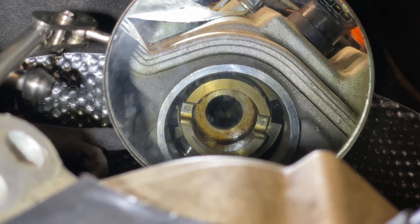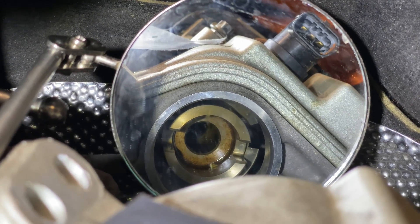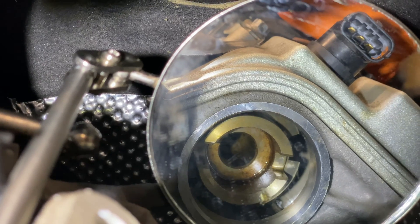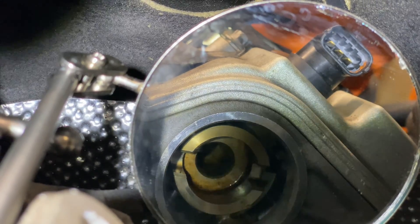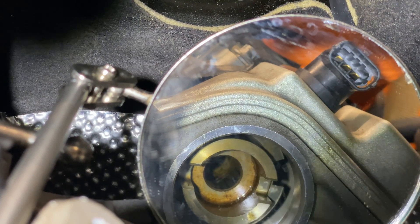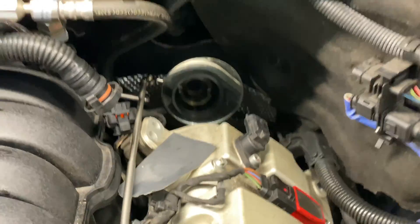We got that out — that is how it should look before you install the new plastic piece. You need to make sure you can see that tan color inside the hole before you put the new plastic plunger in. See how there's no more black inside of there? The stock piece of plastic — I finally got it out. It took some finesse; I had to crack it up with some picks and then I used a shop vac with the hole size reduced all the way down so it could fit in there, and it sucked the pieces right out. It worked great.